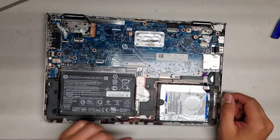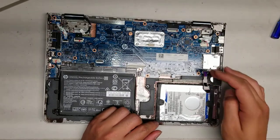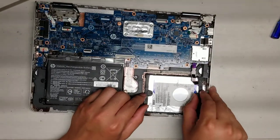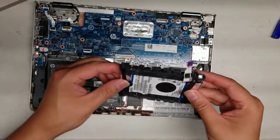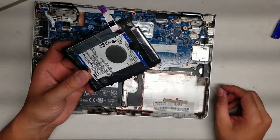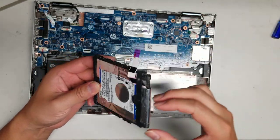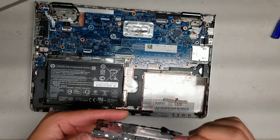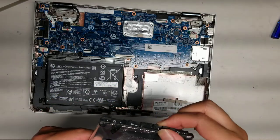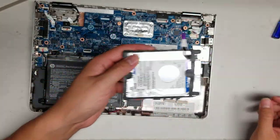The other one actually has a bad hard drive, so I'll show you that one — it's basically the same exact thing. You've got the hard drive here and the connector here for the hard drive. Just flip that up and you can remove the hard drive connector like that. If you need to replace the hard drive, just pull this rubber thing out and the whole hard drive comes up just like this. You can change this to a 2.5 inch SATA SSD. You just have to remove this rubber stuff, undo this foil, and then pull out the connector. You don't really need to peel all the foil out — just the foil from the front to remove the SATA connector.